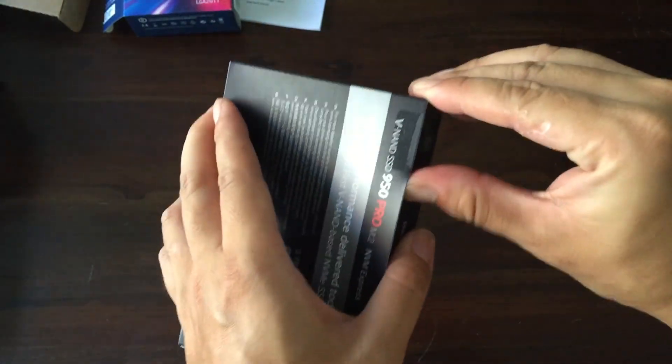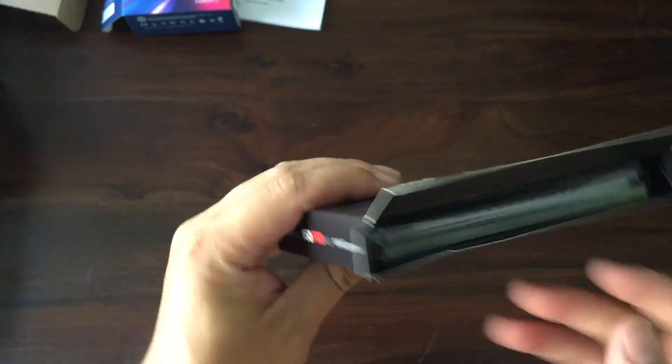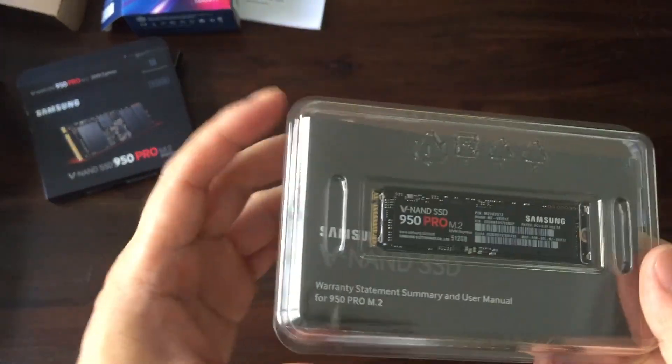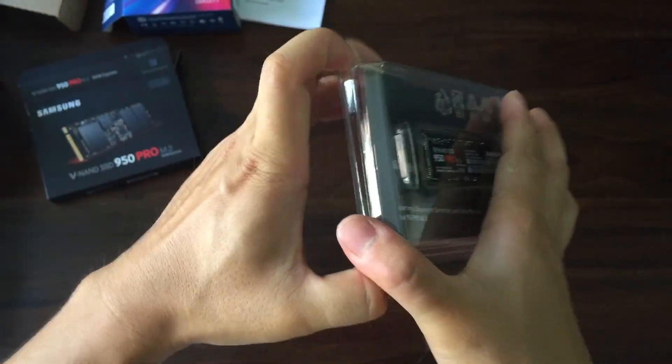Let's get started with the Samsung. I want to see how it looks since I've never seen an M.2 before. It has a very fast transfer speed — I think read speed is over 2500 megabytes per second and write is over 1500. It's actually faster than the SSD in the iMac late 2015 Retina edition, which features a Samsung SM951 series SSD with a slightly slower transfer speed than this one.